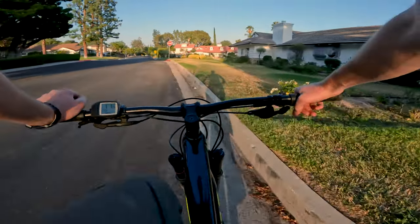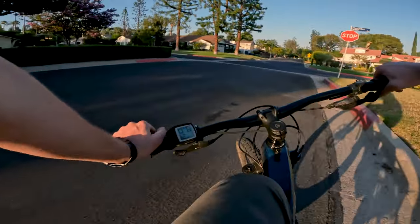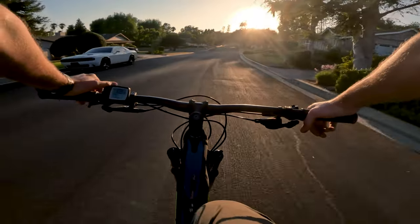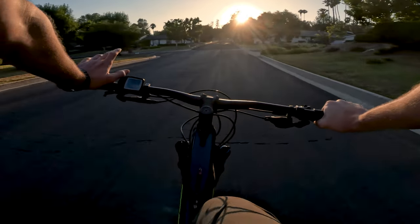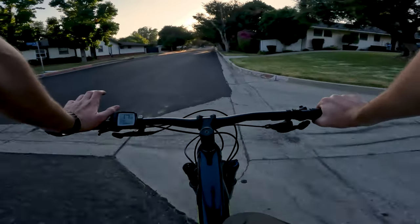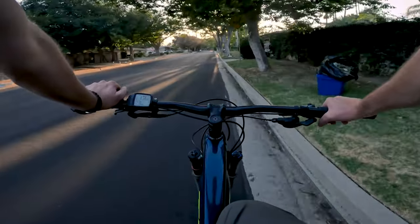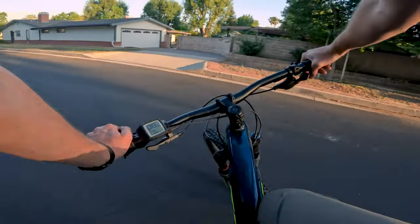Ignore the rotor rub I have — they're just warped because we hit rocks, and that will bend your rotors. If you want a video on truing rotors or straightening out your brake calipers, I can make a video on that too. That's the final step — you've completed the bed-in and now you want to try not to touch that brake for the next 10 minutes. Let things cool down and make sure everything has settled before you use that brake again.